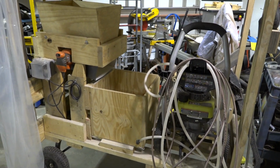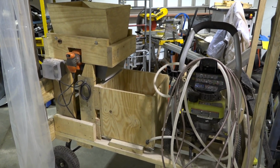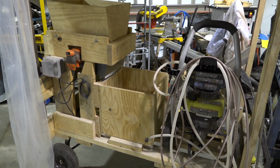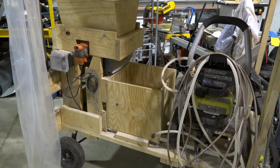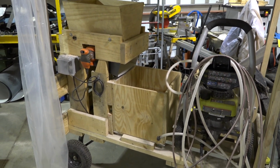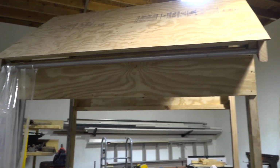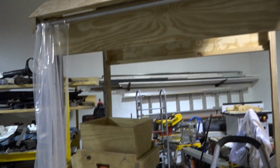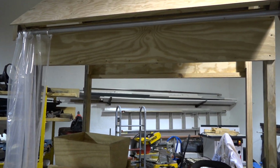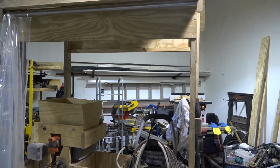because when you're out using a wet blaster, you're going to get wet. Let's just say that. Initially I had said that I thought it would be good because the water keeps the dust down, which it does, but you're still going to get sand in places you didn't know existed, and on top of that, now you're going to get wet. So to help with the rain, I just put a little canopy over the top of it, because like I said, if I'm out there blasting and it starts raining, who cares? I can carry on.